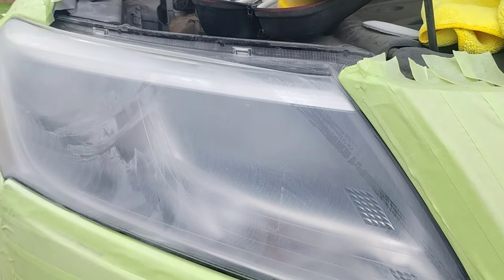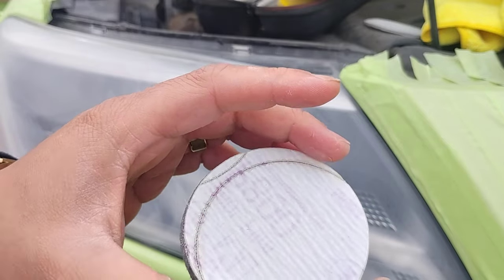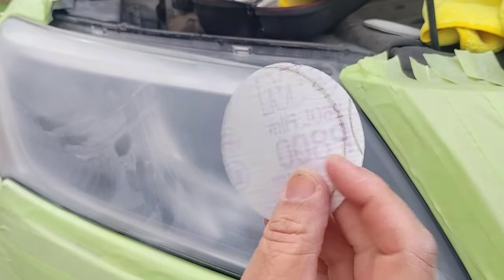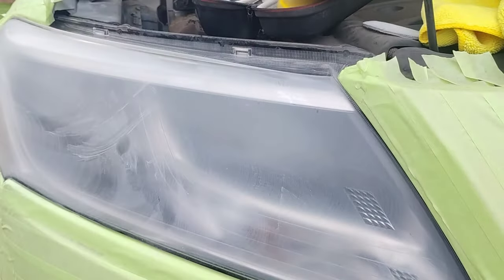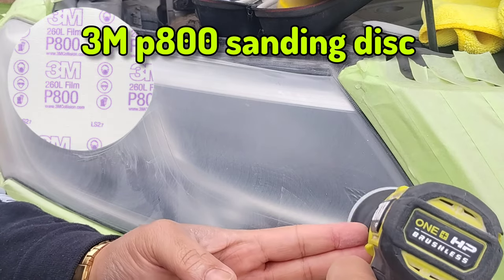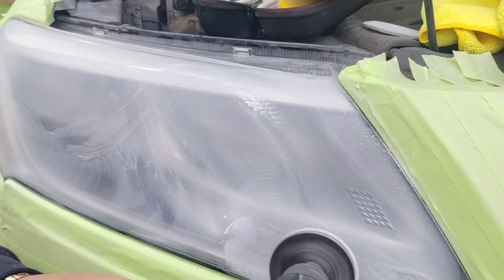Right here you're going to see this disc — I almost didn't catch it. When they manufacture these, apparently the discs come from big huge sheets of paper and they cut them out kind of like a hole punch. You can see how this one was mis-punched and it still made it into the bag. All the rest of it's good, but that little crease where the punch lines are is very coarse. If you use that on this headlight with the power drill, you're going to be gouging things you don't want to gouge, and then you'd have to fix it. So watch out for that — if a disc has any kind of discrepancy, feels funny, looks funny, has any creases or folds, you don't want to use it. It's not worth it.